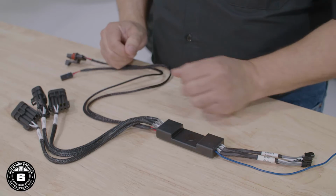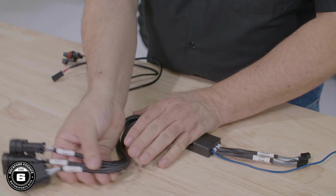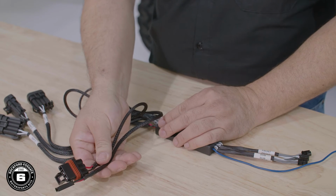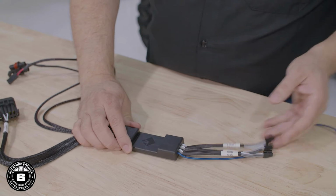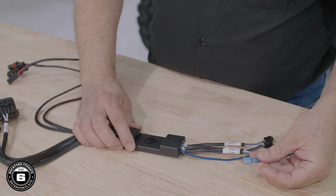The Ride Command interface allows you to use Ride Command as your source unit. One end contains the factory Polaris connectors used as the input signal from Ride Command. It also contains main power and color Optix power connectors. The other side contains audio outputs for connection to the amplifier. It also contains a blue remote turn-on wire to activate the amplifier when Ride Command fires up.